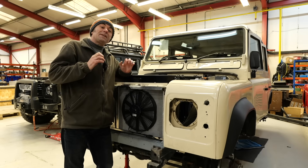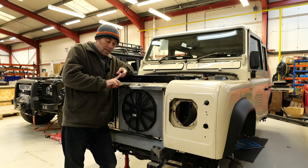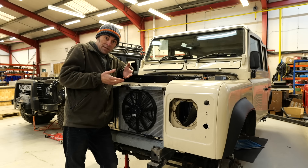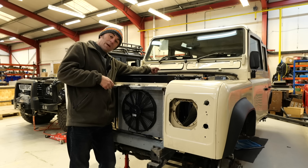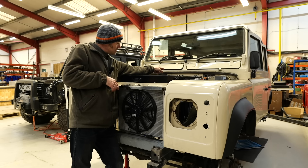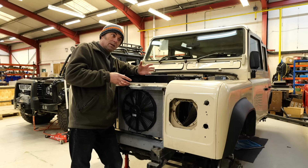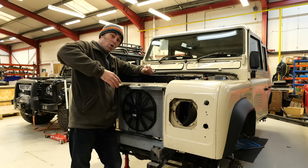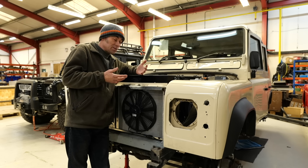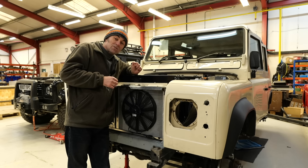So that's a lot of safety systems on modern electric vehicles - everything from the battery management system and thermal management system keeping temperatures and cell voltages where they need to be, right the way up to fault condition safety systems like fuses and pressure release valves. At the back there is the inertia switch - if the vehicle is in an accident, that will trigger and close everything off. And next to that, something not yet mentioned: a buzzer. Because electric vehicles are so quiet, if you've left the vehicle in drive and a door opens, there's a little buzzer that sounds as well. Because we build our vehicles to ECE R100 regulations, we put most of those safety critical systems onto our conversions here at Electric Classic Cars as well.